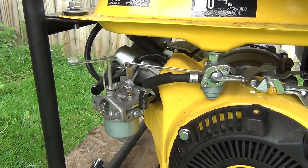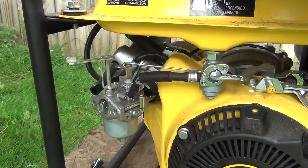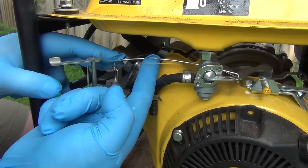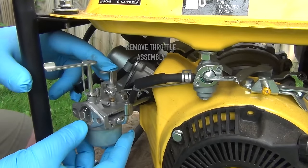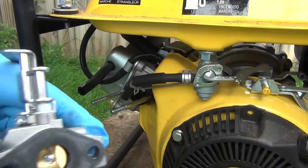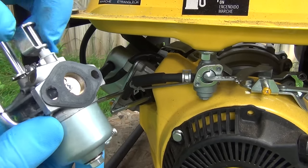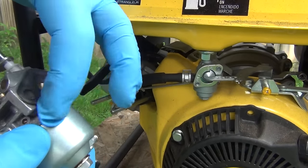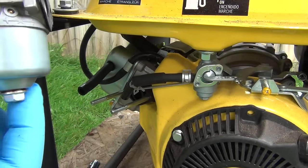The thing has been on there for a long time so it's a little more difficult to get off. The assembly here for the throttle we have to remove too — there's a little spring in there. So all this goes off and then we can remove the carburetor. On the back there we have a gasket again, and the best thing is to leave it on. If you try to peel it off, as you can see here it rips and this will only get ugly, so just leave it on there. And now we're looking inside this thing.